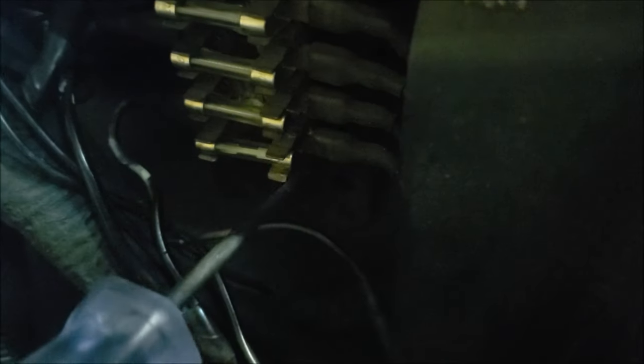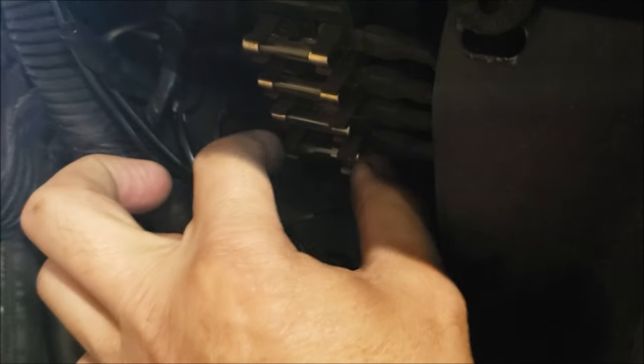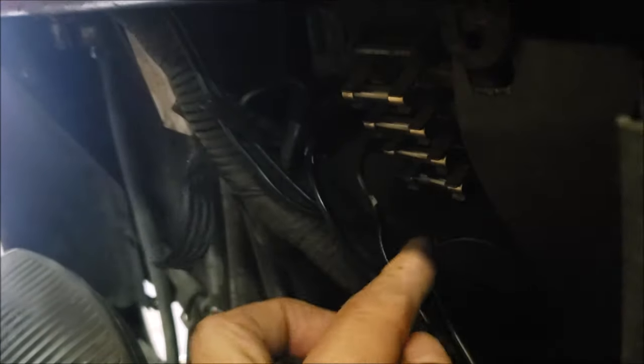Without the fuse, let me try this — now me touching the fuse and the holder together, it came back! I got my display now. Let me move this — oh, it's loose! Look at that — it actually fell out. So what was happening: the holder has been spread apart, probably because it's too close to the pedal and somebody hit it. That fuse, although still good, wasn't making good enough contact. We fixed that.